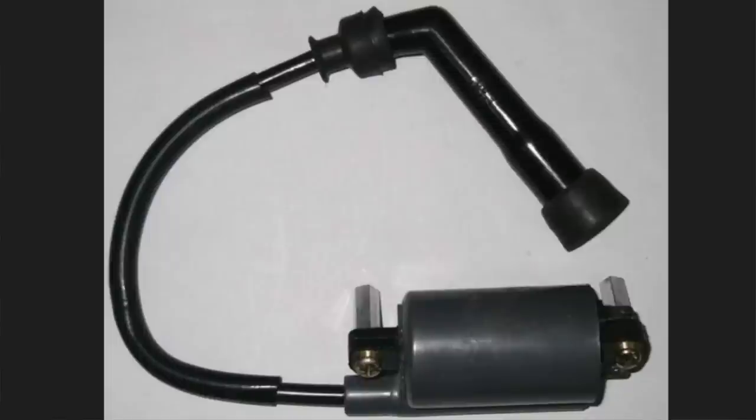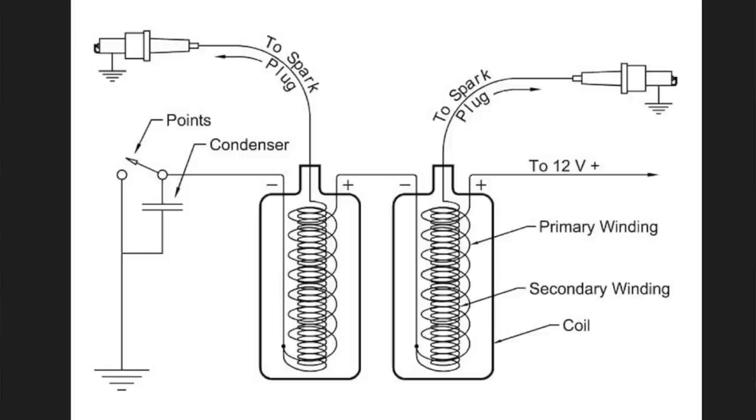The last wire is your green wire, which is your tach signal wire. It goes straight to the coil — to the negative side — which is the one that picks up the signal.